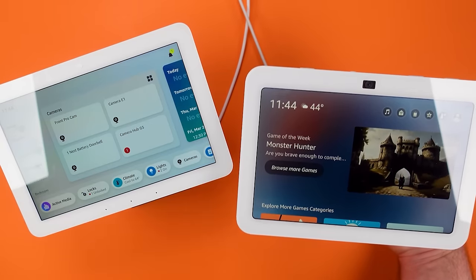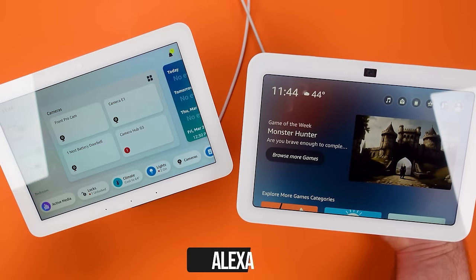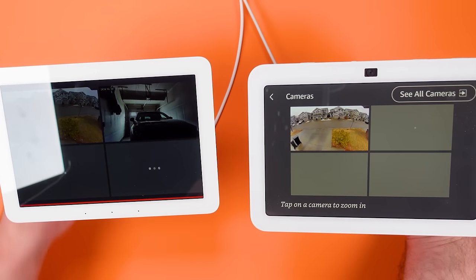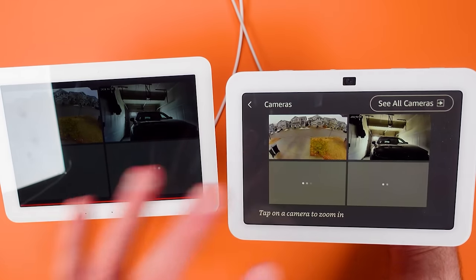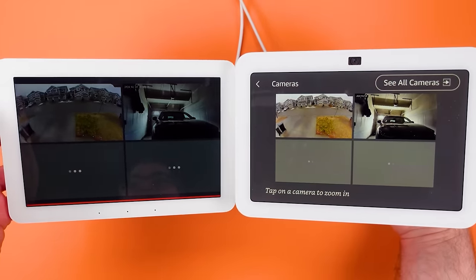The Echo Hub is an 8-inch touchscreen smart display with Amazon's voice assistant on board, so it's a lot like an Echo Show. You can ask it to do all kinds of things, but the feature that matters to us today is that you can ask it to open multi-view. All I have to say is "open multi-view" — that's the command you use to bring it up manually. You can also use the command "show me my cameras" with your Echo Hub or Echo Shows. I'll explain more later how we can use additional commands to customize what cameras show up on our display and how they show up.